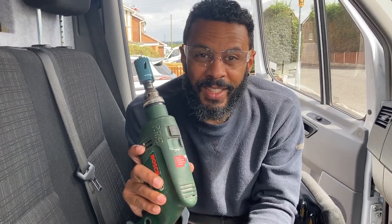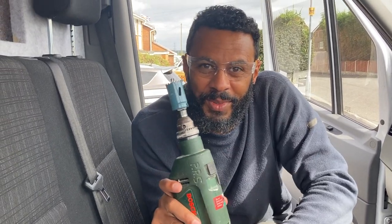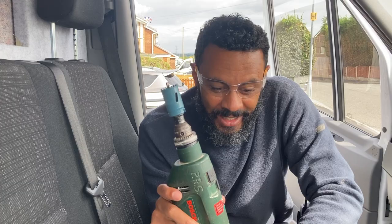So it was the drill bit. Kids, that's a lesson in having the right tools for the job — it went through in about five spins and I had to stop it from going right through the other side of the van. We need to get that hole rust-proofed now, because there are metal shavings everywhere, and they are the enemy — they lead to rust very quickly. So we're going to do that, get the isolator switch in, and then we can carry on with the rest of this battery-to-battery charger installation.